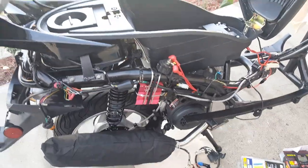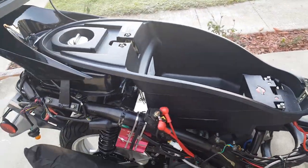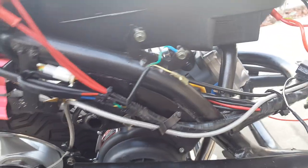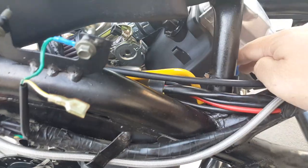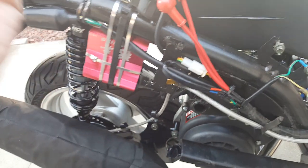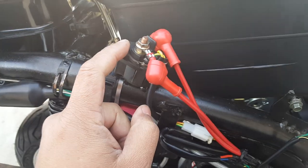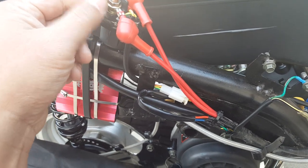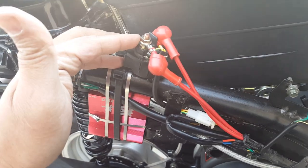This is Michael from NCY Store. We think we figured out why the ignition coil problem is not causing the engine to turn over. It's because it wasn't creating spark in the spark plug. We tried hooking up a portable battery to boost it. Going by hearsay, we caused some pretty good smoking damage here because the bike wasn't properly grounded.